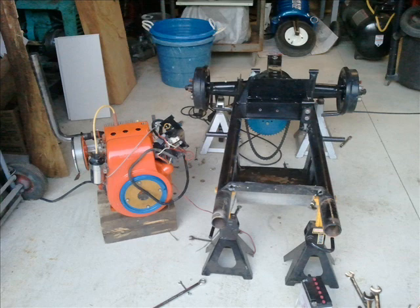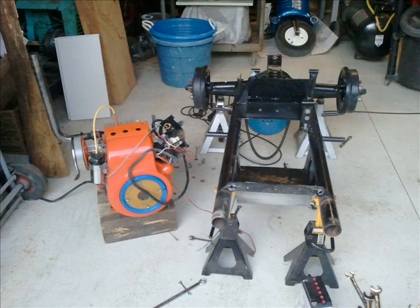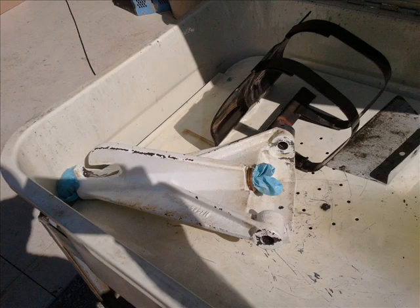The chassis is just the focus of the attention — I'll leave the engine to another day. Here's another closer view of the way the jackshaft adjustment is made for the belt tension. And finally, take all your parts and wash them off in a parts washer.